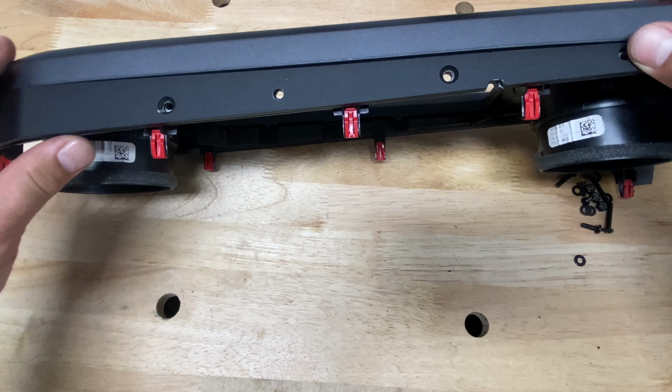Now here, this plug to the left, I'm gonna go ahead and remove it. That starts the truck. Next step is gonna be pop this USB plug out. Now the next step is gonna be remove the plug from the cigarette lighter, which is gonna be my source, the one I'm gonna tap into. I'm gonna remove that and then I'm gonna fish it through that USB plug.